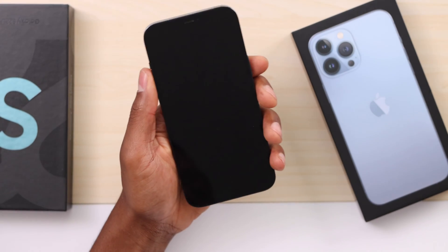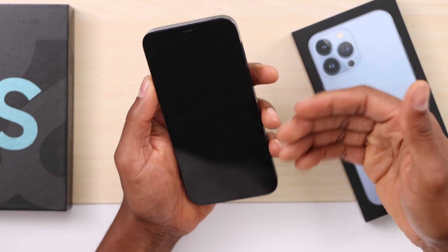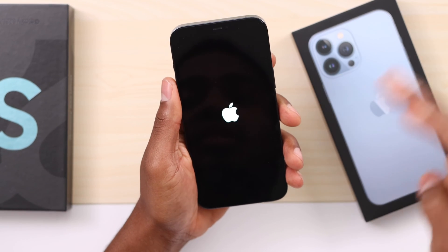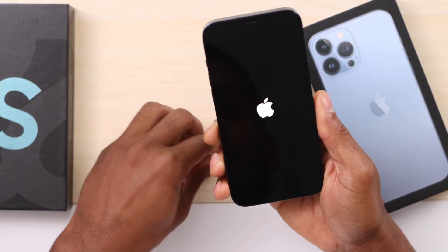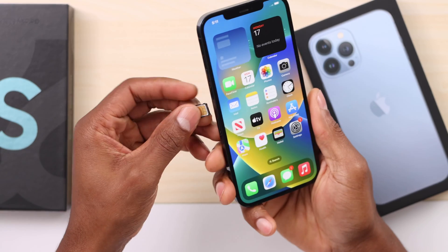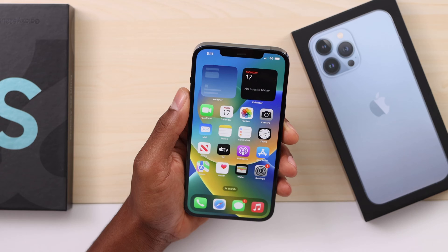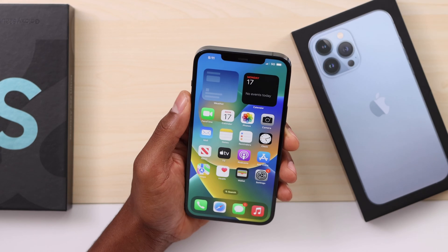Second, just turn off your phone, just like that. Once your phone is completely off, turn it back on. That's the first thing you have to do before changing anything on your iPhone — it's the easiest way to fix the issue. Apple says to restart your iPhone: remove the SIM first, turn off your iPhone, turn it back on, and put the SIM card back in. That might fix the problem. Once your iPhone is on, put the SIM back in and wait a couple of seconds. My iPhone is reading the SIM card now! It happened to me because I was updating the iOS system and after that it was saying no service and stopped reading the SIM — that's why I decided to make this video.